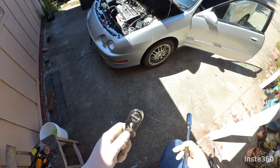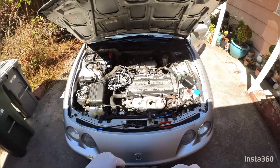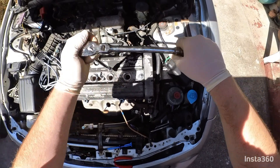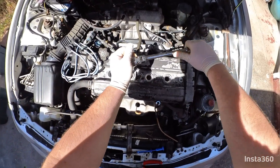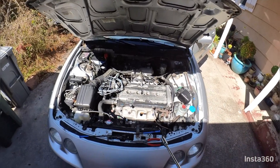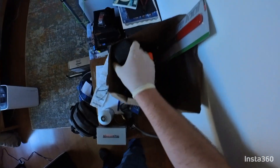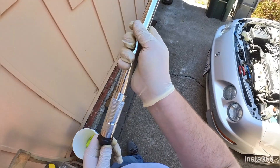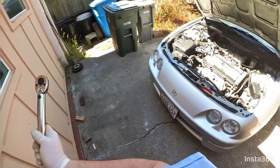Those are tightened. I'm going to use my Snap-on flex head ratchet to finish up — Snap-on is really worth it, they are great tools, especially the ratchets. I'm actually going to get a torque wrench to tighten those down because I'm not really familiar with the feel. These spark plugs are set to 13 foot-pounds.